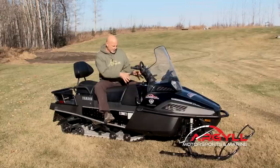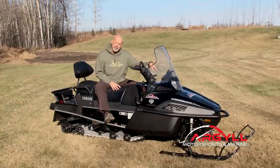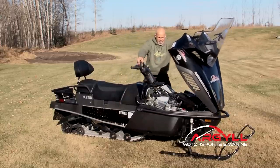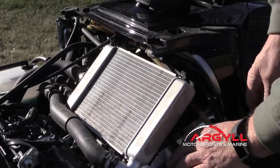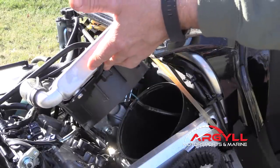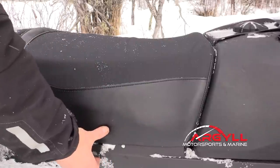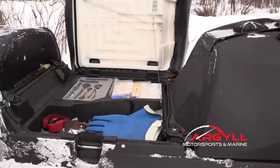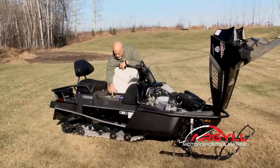The seat is heated. There's an auxiliary radiator here which helps for cooling when you don't have a lot of snow on the trail. Air blows through it and into a duct here, and the duct goes underneath the seat, so you've got heat right under there. Really cool about that is your butt stays nice and warm, but everything in the storage area doesn't freeze — water, lure, sandwiches, whatever stays in there stays nice and warm. That is a really nice feature.